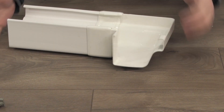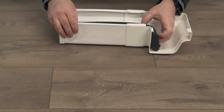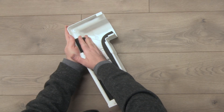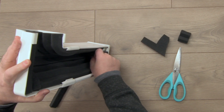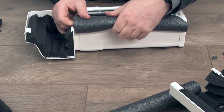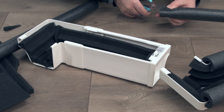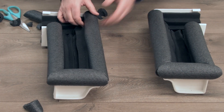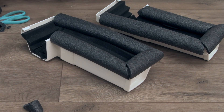It takes a bit of effort to get the piece to snap into place. Apply the end cap and tap it into place. Test fit and cut the pieces of acoustic foam for inside the gutter, then spray them with the adhesive — it's messy, so work on old newspaper. Apply the acoustic foam to the inside of the snorkel assembly. The surface doesn't have to be absolutely covered, so don't worry if there are small gaps between foam pieces. Next, fit and cut the foam pipe insulation. It comes with a slit in the tube, and that will slip over the edges of the gutter. This insulation helps the edges of the gutter conform to the curved contour of the oxygen concentrator. I first fit the foam onto the gutters and then cut mitered corners, so the slit in the foam is lined up in the proper direction and the corners will fit together closely enough for the sound to not escape through large gaps. The bottom of the snorkel scoops doesn't need this foam. The foam kind of hugs onto the gutter edges, so no adhesive is necessary.